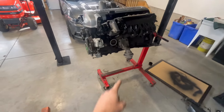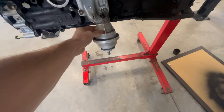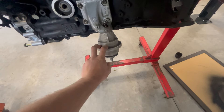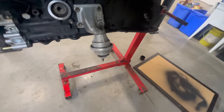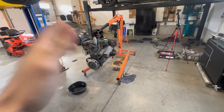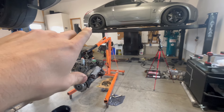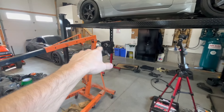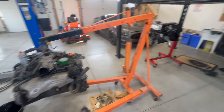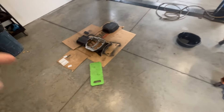I've transferred the motor mounts over — these are actually TRD engine mounts bolted up to the factory motor mount location. I found a lightly used set, which is great because TRD ones are hard to find now. The 2JZ blocks are essentially identical to each other — the GTE has a different cylinder head and extra piston squirters underneath for extra oiling, and different pistons, but the blocks stay pretty well the same.